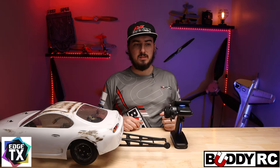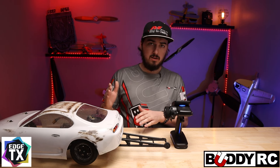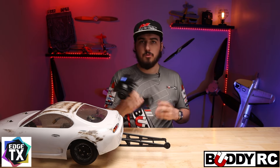If you guys have any questions about this setup, let me know. This setup definitely took a little time to learn, but I absolutely love working on this kind of stuff. If you guys have any other setups you're wondering about, give us a holler. I think the drag guys will really benefit from ELRS because it's one of the fastest systems out there. The receivers are $16.99 without an antenna on it — super small, easy to put wherever you want on the car, not a lot of weight. The remote is cheap, the controller comes with a receiver — it actually comes with the three-channel one without an antenna. So if you get this, you're ready to go into your drag racing stuff. You could do all this programming and more. If you guys have any questions, comment down below.